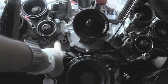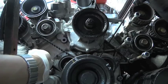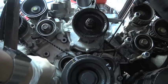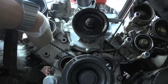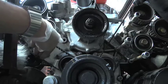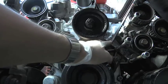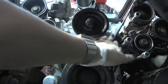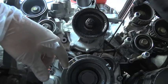If the tensioner is not in good condition, you're going to have problems. So just to recap - the correct way of doing this. I think that's the note I'm going to go with, because that's a nice amount of twist on the longest run. Don't do it on the short run, but on the longest run. That's a nice note - not too tight. These were done by Ferrari, but I don't think they used a clavis gauge.